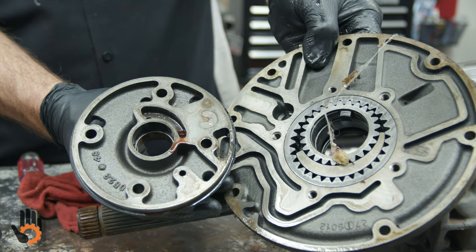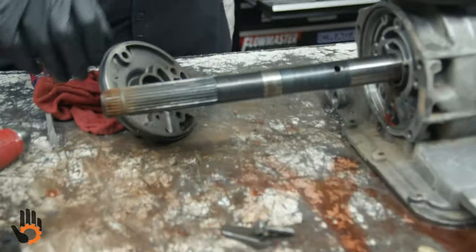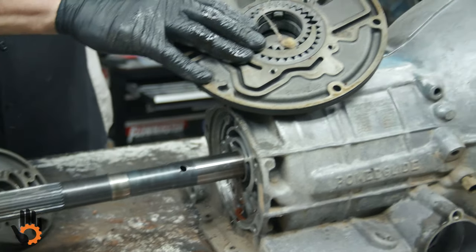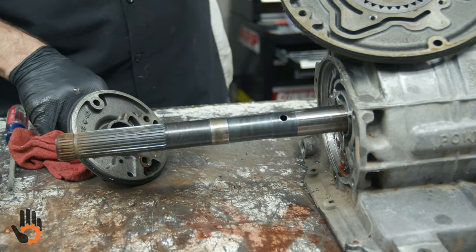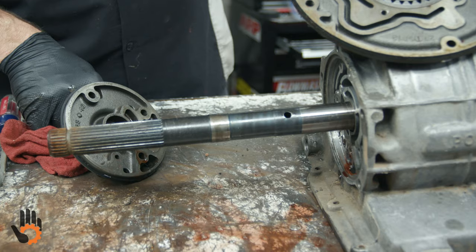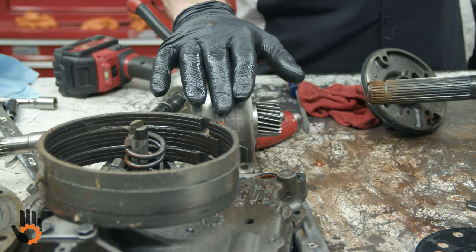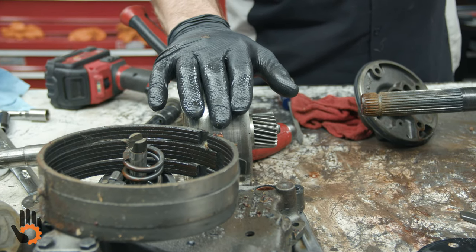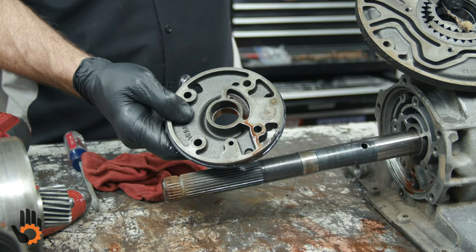Ford, Chevy, I think Chrysler even used that back in the early 60s, and it was driven by the output shaft itself. It was actually lugged or anchored to the output shaft. So unlike where the front pump on these was driven by the torque converter, always spinning at engine speed, the rear pump was only driven as long as the vehicle was moving, if you will. And just as a note on that, these are vehicles that could actually be push started even though they were automatic transmission. You can actually turn the key on, place them in gear, get the car rolling about 20, 25 mile an hour. That would activate the pump. That would create enough pressure to apply a set of clutches or a band, connect you through to the engine, and actually turn the engine over, and it would start and run. Just had to get the vehicle moving fast enough in order for that to happen. This is a little later, probably after about 65, 66, so no rear pump in it, just to support itself.